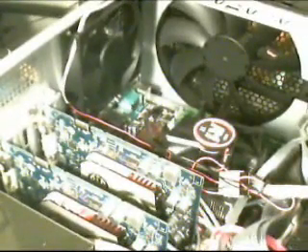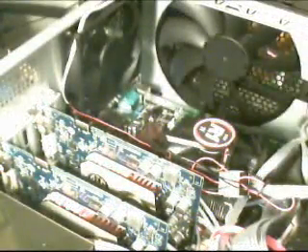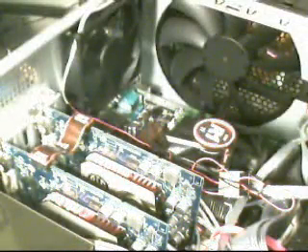I have the two video cards in now — they were easy to install, just snap them in. As you can see there are two video cards and this is an SLI-ready motherboard. To get SLI to work you actually have to connect the two video cards. If you look here, there's a port on each video card at the top in the same spot. Every SLI-ready motherboard comes with something similar to this — it's called an SLI bridge. Basically it bridges the two cards together. You place one end on one card and the other end on the other, and SLI is enabled.